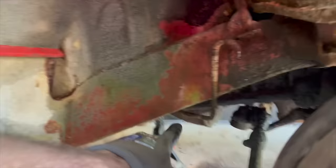So here's what I'm gonna have to make. This is your typical 3/16 metal brake line. That's what most cars have. So I gotta make it to go back up under here, under the frame rail. Solid frame rail too. And it comes snaking up through, oh, we don't say snake, up through here.